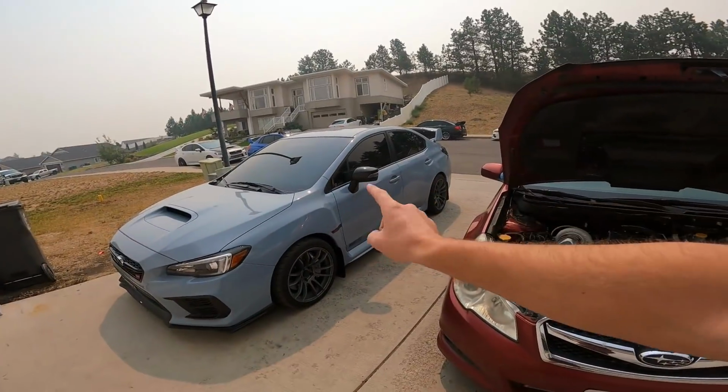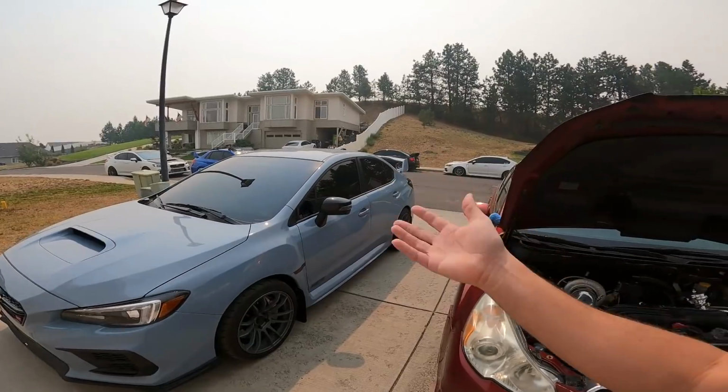Now, it's not going to fix it always by just changing the fluid, but usually when you drive them about 500 to 1,000 miles, and the more miles you put on it, it seems the smoother they get. This had a terrible fourth gear grind because, well, your boy killed it on one of the Mexico nights with Kellen. Maybe I'll be able to find a clip to put in here for you. I got locked out of fourth and I just sent it on the limiter, holding it, trying to go in because, well, I didn't want to lose to Kellen.